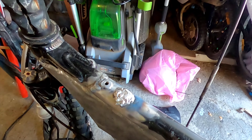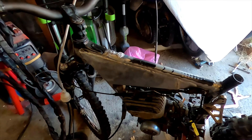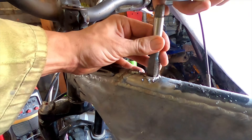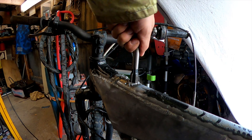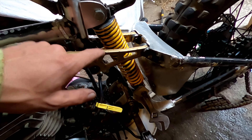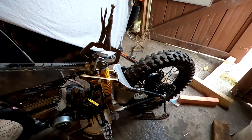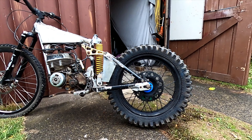There we go - I've got a bit of a lump there. I can now drill and tap that big enough to get some fuel in, but I don't like welding fuel tanks because this has already had gas in it for the first ride. Okay, that's drilled and tapped - I can put a bolt in there. I'm gonna weld this to here and tack that onto there, hoping that it's gonna work. I've got that in there now and I've been testing it - it kind of works.